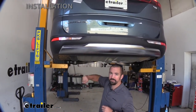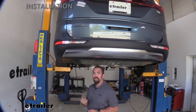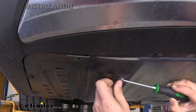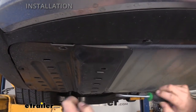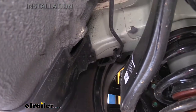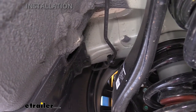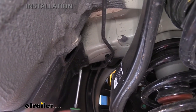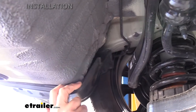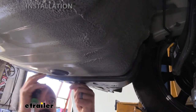Starting on the driver side, you're going to see the underbody panel. There are six plastic push pins that you'll want to remove — keep those in a safe spot for reinstallation. A flathead screwdriver works well to pop these out: put it in the little slotted gap and give a quick twist and they should pop out. Note that one pin is tucked back and one you don't actually need to remove, so make sure you have the correct pins removed before pulling the panel down.